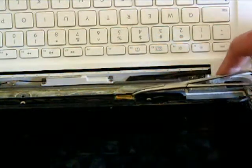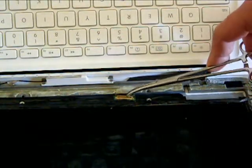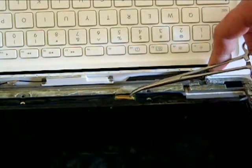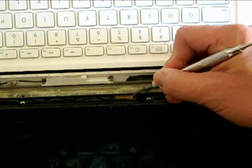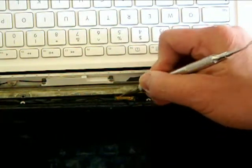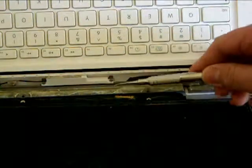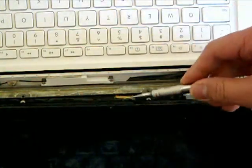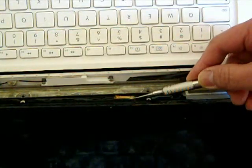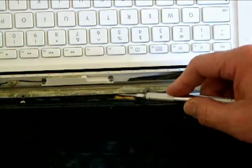Hello. The first section of this video is a recap on video number one, where I covered how to replace the screen of a MacBook 13-inch notebook. I used surgical tweezers to help reconnect the video connector to the circuit board of the LED screen. I also removed the conduit plastic where the cable runs through to give extra space, and stressed the importance of securely fastening the retainer clip for a proper connection. If you missed the first video, please check the link below.